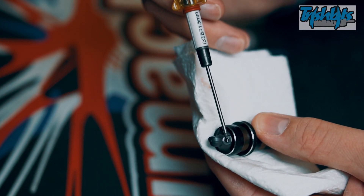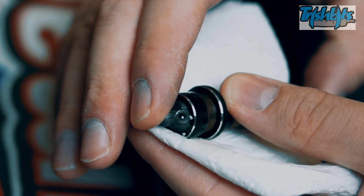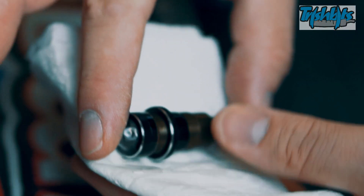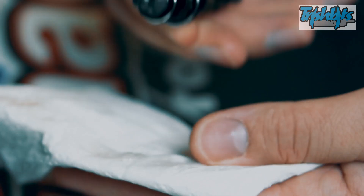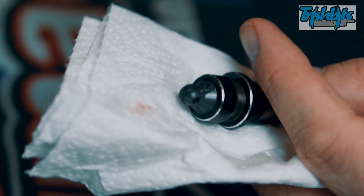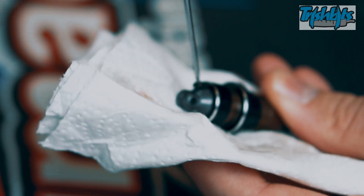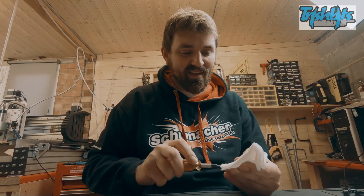For the sake of the camera I'll make a mess - I'll squidge it up and watch it all pour out over the shock collar, all the way to the point that the shock is pushed all the way in. That should be enough to do the job. I'll give it a little extra wipe and give it a second - no extra bubbles are going to come out. Then I put my bleed screw back in - let's call it the bleed screw for proper terminology. Screw that down, meet the bottom, don't overdo it.